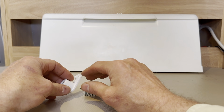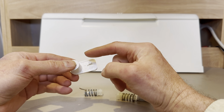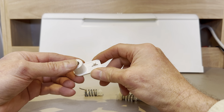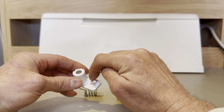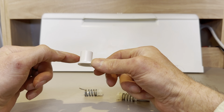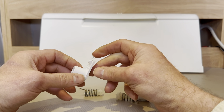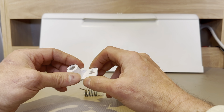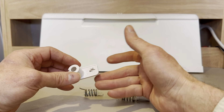If you're watching this video because your freezer door sags open, chances are that one or both of your spring housings have broken. They usually break along a jagged line somewhere through the arm or the barrel of the spring housing, because there is twisting force or torque that this part is exposed to, and eventually it breaks when the plastic gets overloaded or just gets brittle with age.